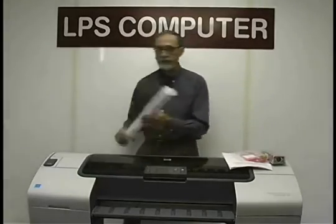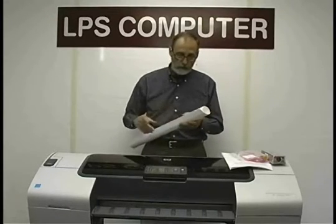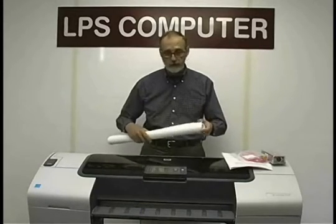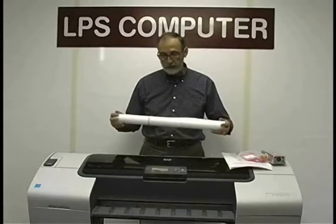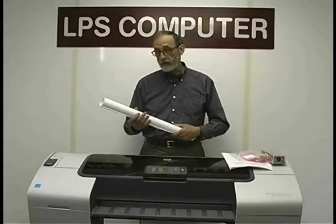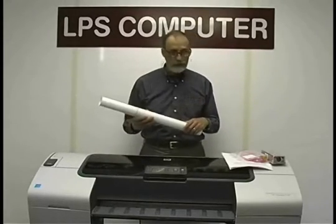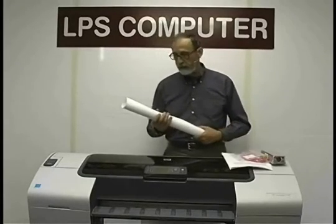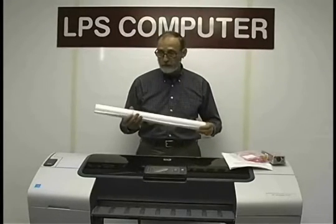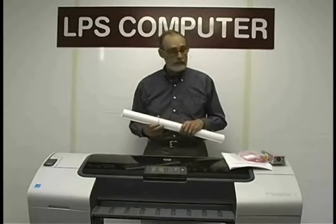Nice thing to have. This is calibration medium. It's a high-gloss photo-coated plastic. The reason we like to use the plastic for the calibration is because it's very resistant to expansion or contraction because of changes in temperature from your hands or from the environment. And also, when paper absorbs the ink, it expands. This won't. The ink stays right on the surface on whatever the coating is. So it's a very stable medium that we've used for many years and fixed thousands of machines, calibrated thousands of machines with this. So we're very confident that this is the best possible option for calibrating the machines.